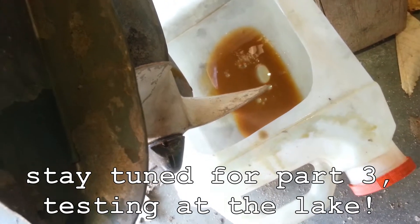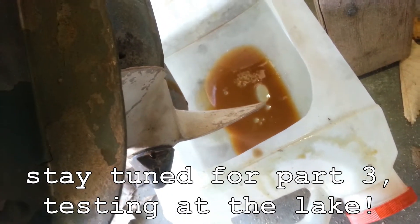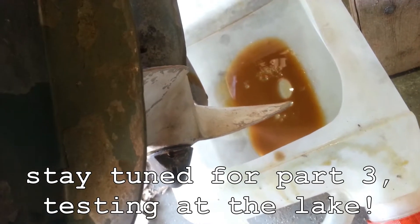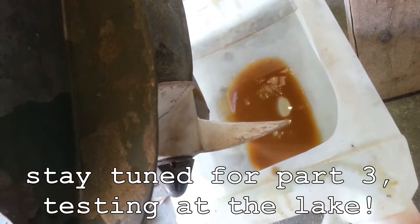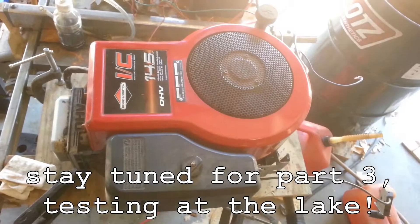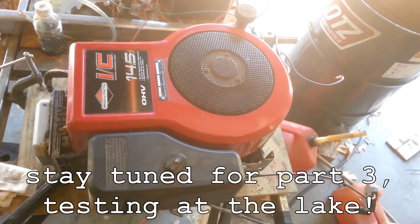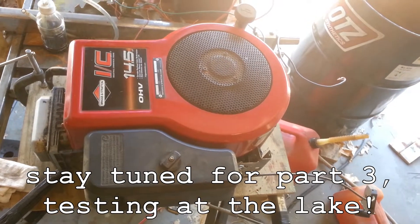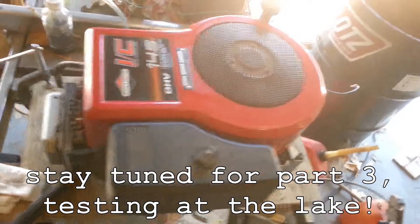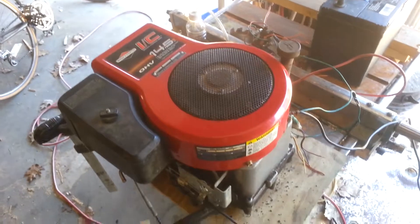I'm also changing the gear lube in the lower drive — drained out the old. There wasn't much oil, and there was just a tiny bit of water, but the color of the oil seems good — not milky, not gray — so those are good signs. I was up at the scrap yard the other day and found another 14-horse just like the one on the boat motor. It's a little bit newer — same displacement but they call it a 14-and-a-half. It's a little dirty but I've already had it running and it works good. Doesn't have a recoil though.